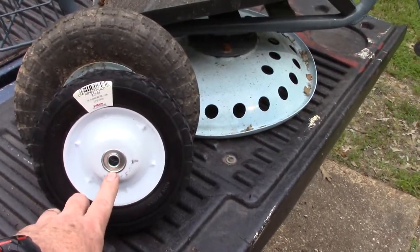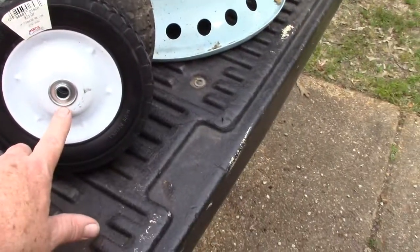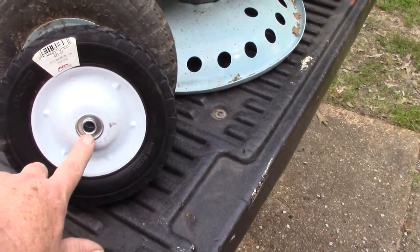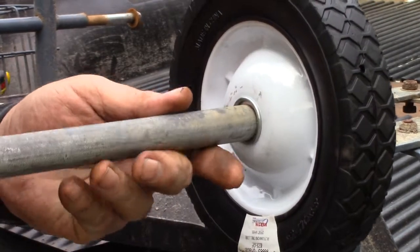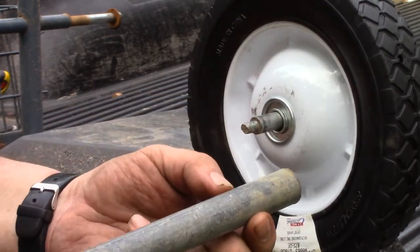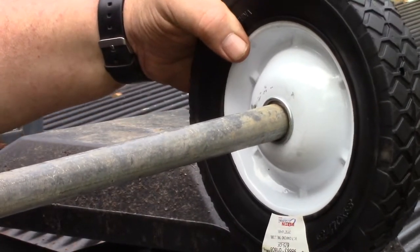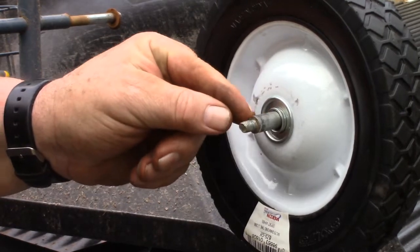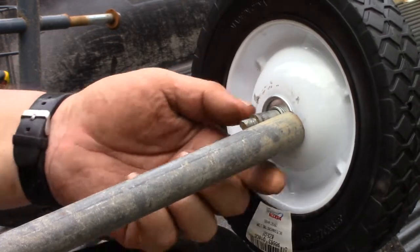Again, on these you need a half-inch diameter on these axles — that's the key thing. Most of them you're going to find are five-eighths, but we'll put the link below for the ones that are half inch. So I've got me a piece of pipe and the size of this is such that it will fit over the axle. Then I just need to put a big washer on here that's bigger than the diameter of this pipe to hold that on. That will act as a spacer for these wheels and keep them from wobbling and drifting back and forth. So we're going to measure this width right here and cut the pipe to the same length, and then put that on there.